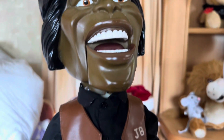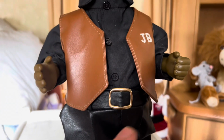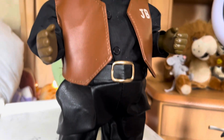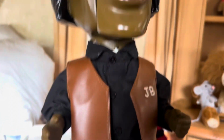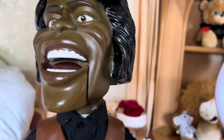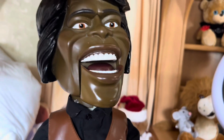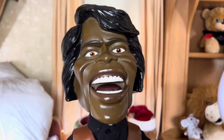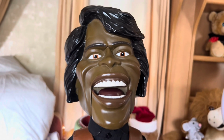So I'll go over the repairs needed that we've already done in the video, but I'll mention them anyway. The hip swing had a split gear, which was very easy, and I've also replaced half the gearbox for that because of how yellowed it was. The head turn also had a split gear. It still does unlock itself from the gears. There's one gear with a missing tooth in there, but it does work fine. Apart from that, you can't really see that it's affecting it.